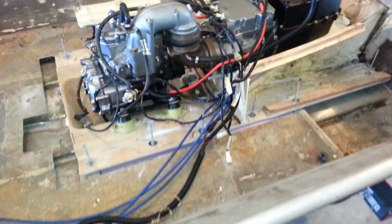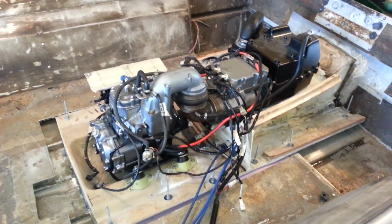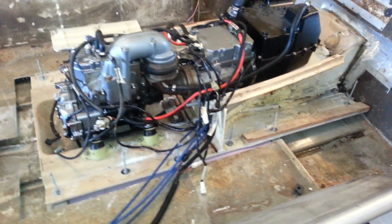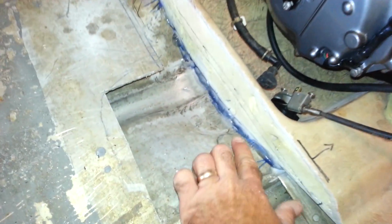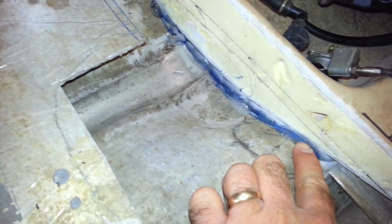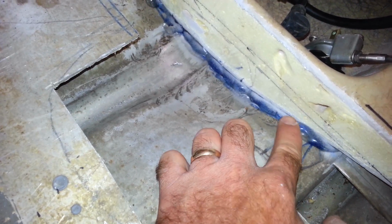Alright, here is the jet ski Kentucky Jetjon. What I've got is a jet ski hull that I mounted into my John boat, as you can see. I've used geocell. You can kind of see some of it over here. It's been about 4 days and still pretty soft. It does take time to cure, I guess, being a little thick. Half inch, mounted it with carriage bolts, 6 on each side.